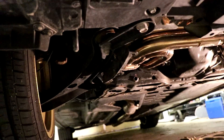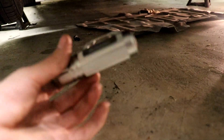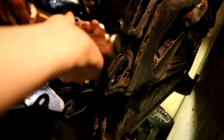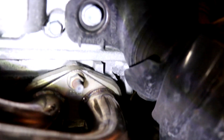Wow guys, I am in shock right now at what my exhaust leak was. Good thing I checked this out because I got my super bright LED flashlight out and started looking up in there, feeling all the bolts to see if they're tight. Then I look up at my headers and — there is no bolt on that header! You see that? Look how the other one has a bolt way over there. There's a bolt... no bolt. What? Then there's a bolt right there too.